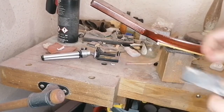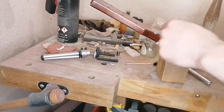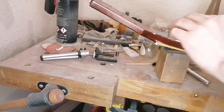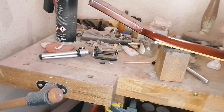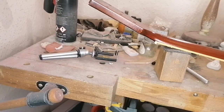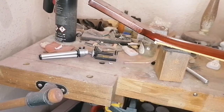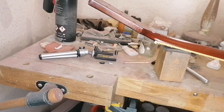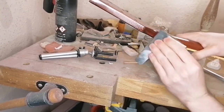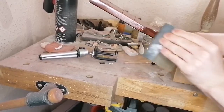But I need to clear coat over that, so I'm basically undoing 5 seconds of colouring. Just going to scuff this with 1200. Yes, 1200. Add a foam block. There it is. I'm just wrapping it because, like I say, just a quick scuff sand.